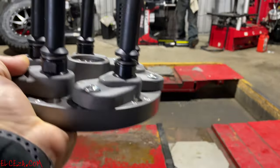Again, get after it if you want to, but this is meant to be eased down on, not stomped on. The only time we want to stomp on it is if we have that problem where our RoadForce drum has come down, nobody has cleaned our spindle, it's dry as a bone and the wheel wants to come off, please feel free to stomp on it and stop that spindle. Raise that hood at once before it runs into the side of a $100,000 car. Okay?